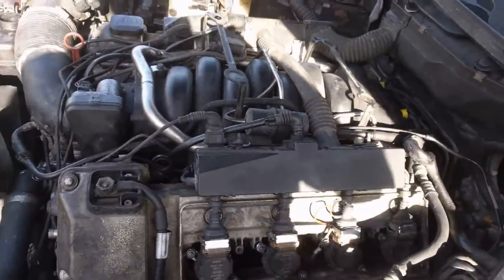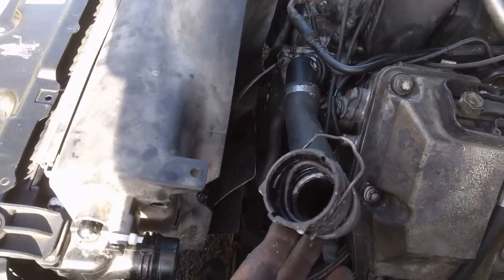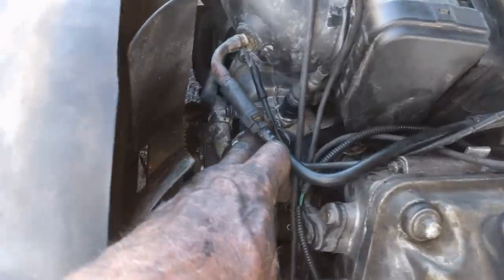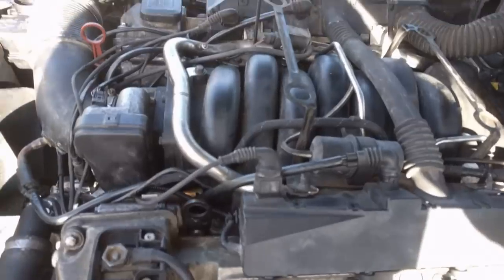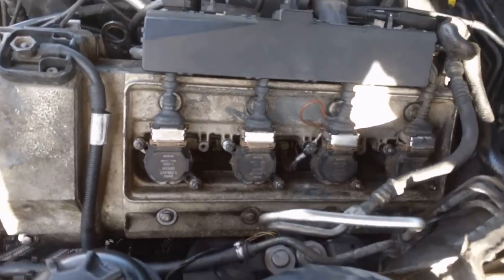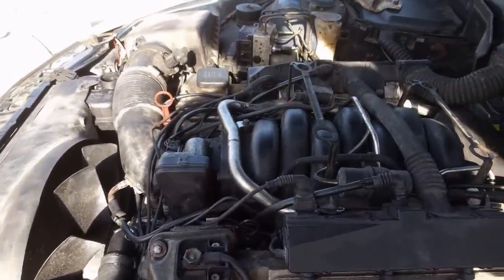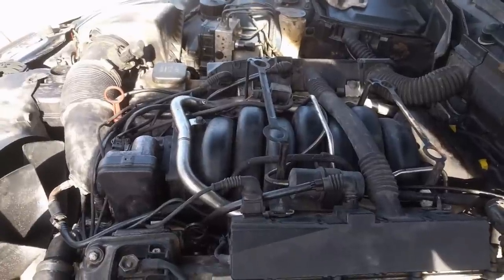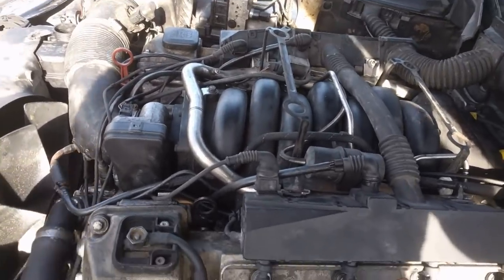I think it's all back together - just a couple of things. For filling it, I leave this radiator hose open. If you dump antifreeze down in the hose until it fills up, it goes down to the crossover tube in the back and supplies antifreeze all inside the block. Everything's pretty much plug and play - just got to find the right plug for it. Double check yourself one more time and when you first start it up it's normal for it to miss a little bit. Don't give it gas, just let it sit there and work its way out and it'll come back. Subscribe - I've got a lot of other videos for BMW stuff. Thank you very much.